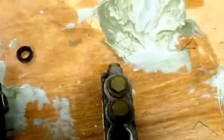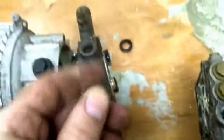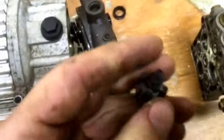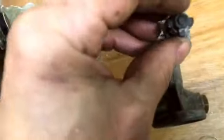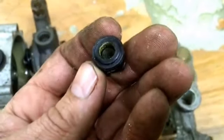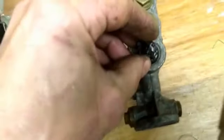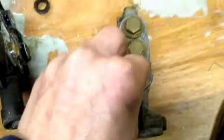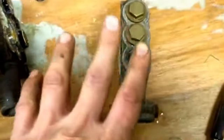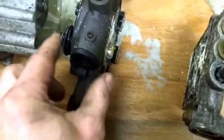Most manufacturers will sell you these non-return valves, but unfortunately most don't come out easily. Most have got little baby clips that slip in and hook on the side past a little ridge, so you usually have to destroy them to take them out. Sometimes they're the other way up and you can actually see if there's muck stuck in the valve. Another trick — something like a piece of straw can come up through there and get stuck, which you can see and deal with. That's one of the common faults.